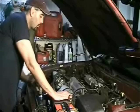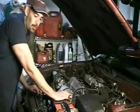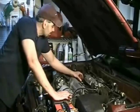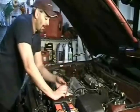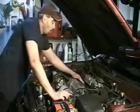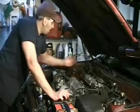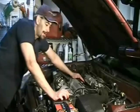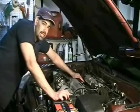With the car warmed up, I'm going to do some tests to find anything obvious before the test drive. The first thing I do is take off the oil cap again and look under — I'll do this quickly because with the engine running it can get a little messy. I'm checking to make sure there's no evidence of coolant in there, then I hold my hand over the hole and feel the blow-by. On most older cars you'll feel some puffs, and that's perfectly normal — you just don't want it to be really, really strong.